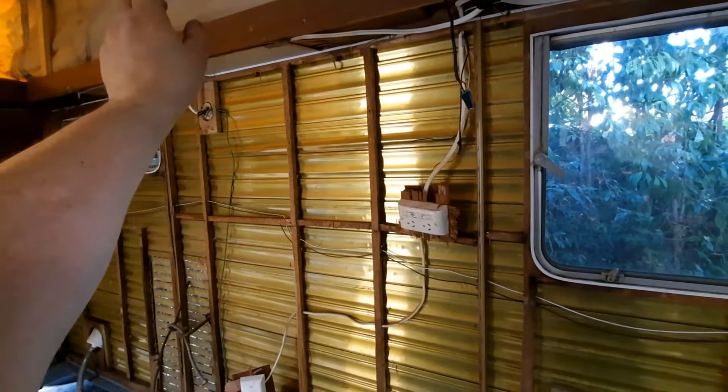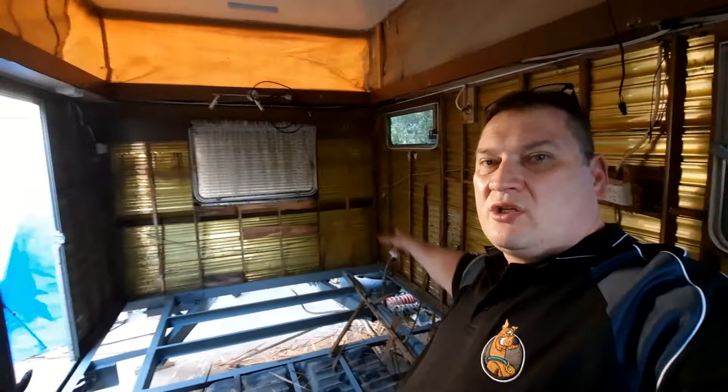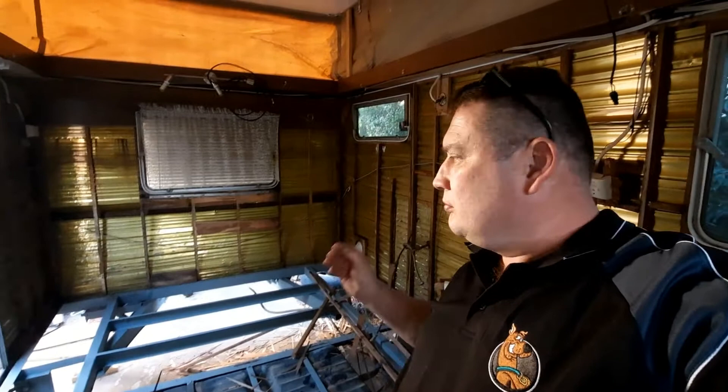The 240 volts is going to come there, and all the 240 volt I'm going to put safety switches and that type of thing in here. We're probably going to do 12 volt circuit breakers and stuff in this area, and then 12 volt radio switches and all that - all the controls 12 volt there, from up to there for the TV. So I've got a rough idea what we're going to do. I'm going to do the bed where I am, chairs where the wheel wells are, then a bench, fridge, and a bench. The idea is to get the framework done, get the insulation in, and then we can start skinning the walls.